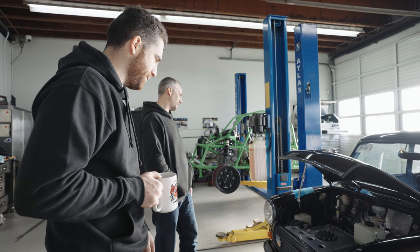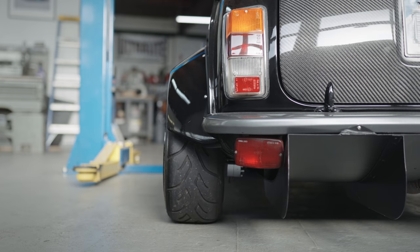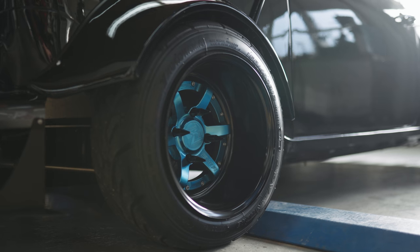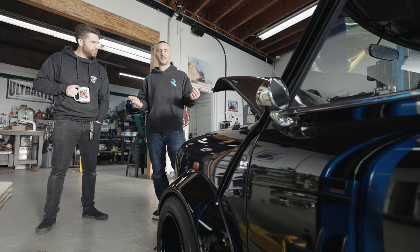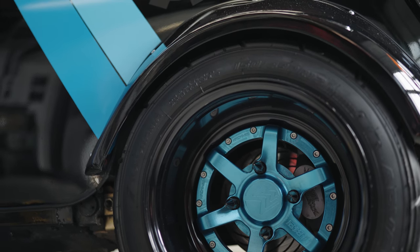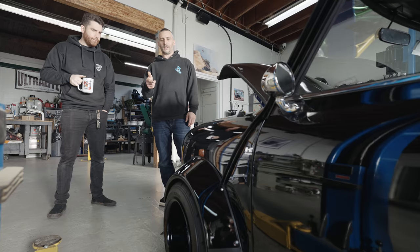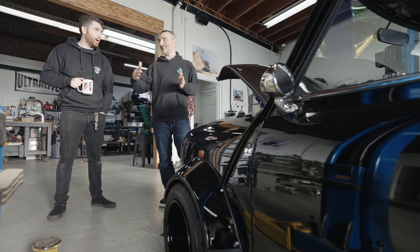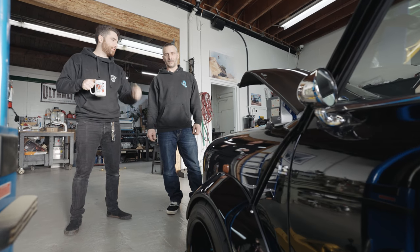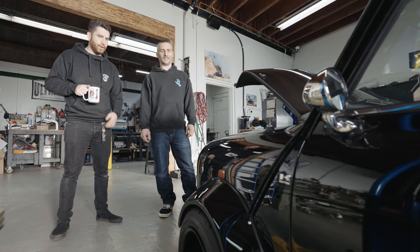Running Miglia flares because they were the widest ones available, needed to run wide wheels. The wheels are actually ATV wheels with custom-machined centers fitted to this application — custom offsets so the wheels sit flush with no spacers. These are 12×7 with a 2-inch backspace, giving 5 inches of dish. Because it's mid-engine, there's no scrub or torque steer issue, and the steering is way lighter than it would be with the engine up front.